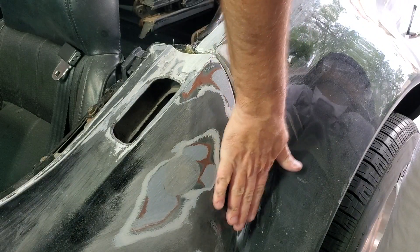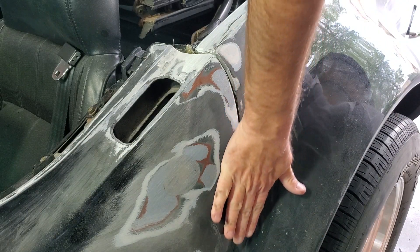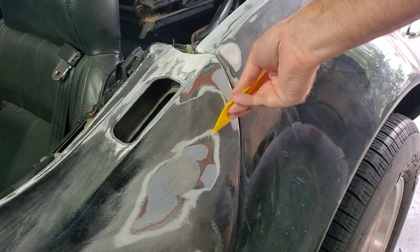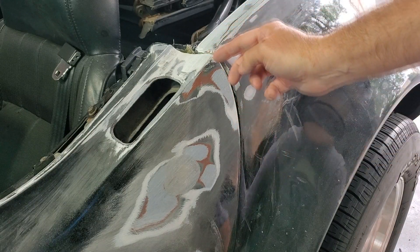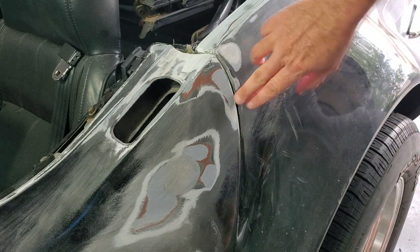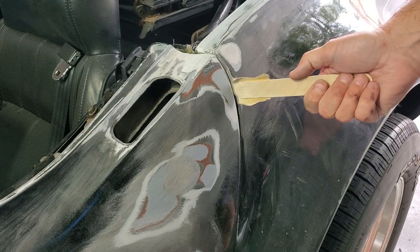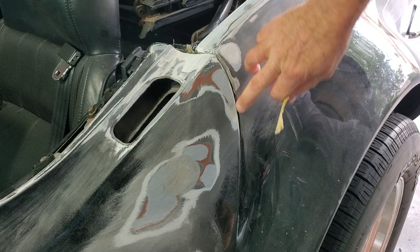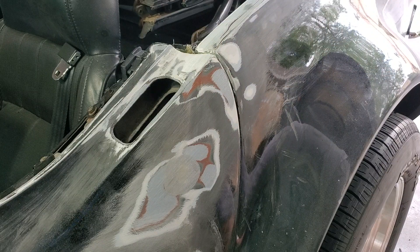I'll even it out a little bit and there's less sanding. The whole door panel is kind of low, but I'll worry about that later. What we're going to do is take a skiff going up that way, take a toothpick, go along the door — that way I know what gap I need there. Then we take a little Popsicle stick and sand it back and forth, but we need to get that initial gap first. That's the easiest, quickest way to do that.